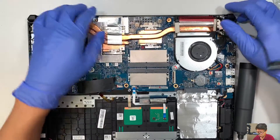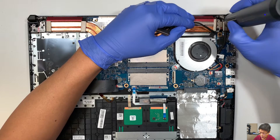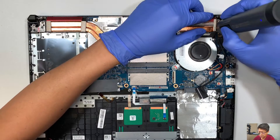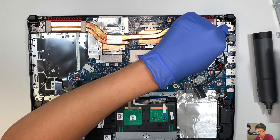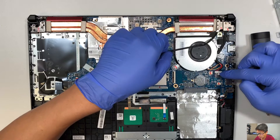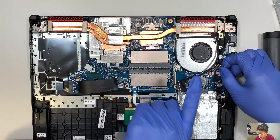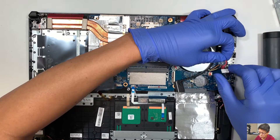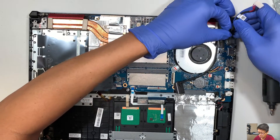Now let's come back here. We're going to finish up the rest. This is your DC jack connector. If you break your DC jack — assuming something happened to the connector, you plugged in the power connector and accidentally broke it — and if just the DC jack is broken and nothing else is bad, then you can just replace the DC jack. This is a replaceable DC jack that connects to the motherboard. To remove the cable, slide it away from your body. I like to use a push-and-pull technique — one finger is pulling and the other finger is pushing — to remove any cable very easily.